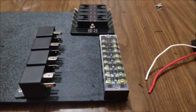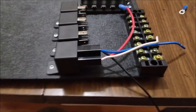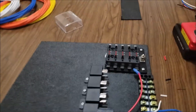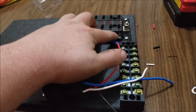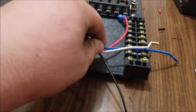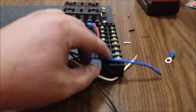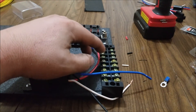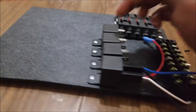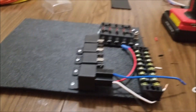I also have another relay but I can't think of anything to use it with right now. If I knew half of what I was doing I would have done this a little differently, but: red wire goes to the fuse box, black is the ground, blue is the power, and white is the activation switch. So they'll be run all the way down — blue, blue, blue, white, white, white — and it's going to be like fan, fuel pump, and I'll figure the rest out.